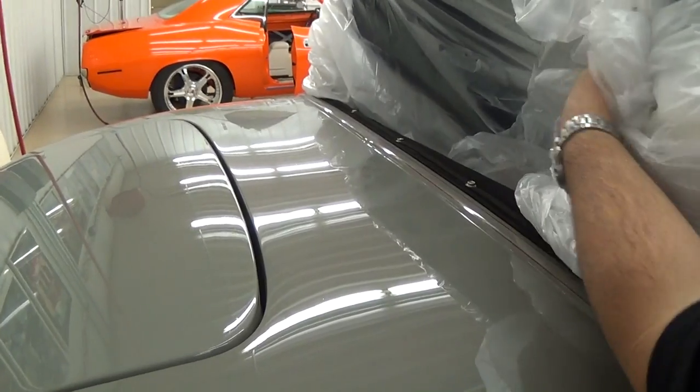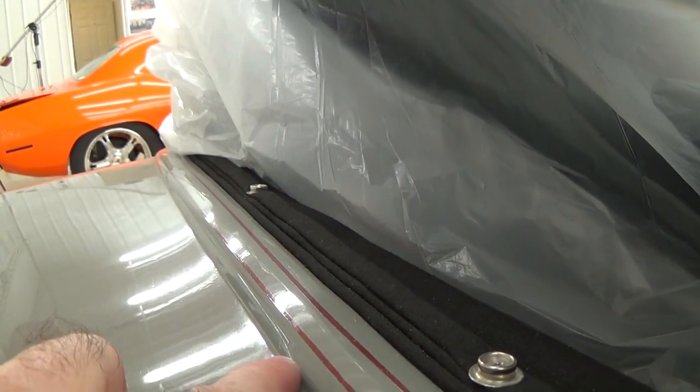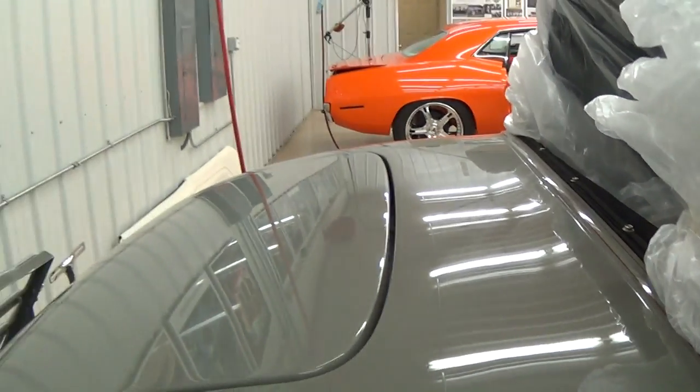This is a good point to bring out about the paint — what had caused this mishap. You can see how that paint is starting to lift and bubble up right there, and that's happening all over the car. In just about every tight spot. It usually tells me the paint was rushed, maybe the primers weren't done right, maybe there was no epoxy put on, or they put too much material on too fast. As it cured and dried, it pulled out of the deeper areas as the surface dried. The paint will actually sort of stretch as it dries — the surface tension of the drying, if it's still soft underneath, it'll pull it up off of there.